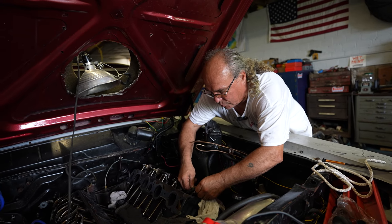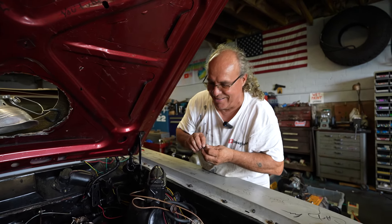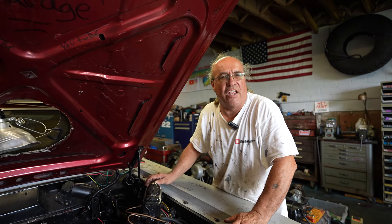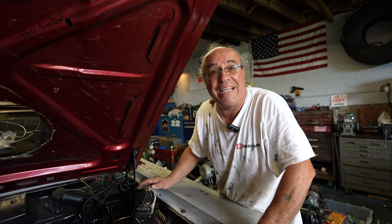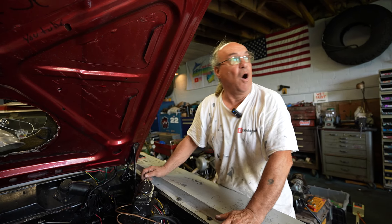Let me just give this a little — yep, she's good. Get this last one done. I'm very excited; I want to hear this thing run again. I remember my father telling me: if you're gonna upgrade the springs and upgrade the cam, break it in with the old springs first, then take them out and put the new heavier springs in.